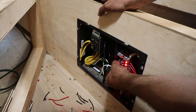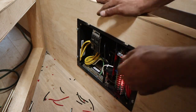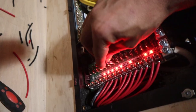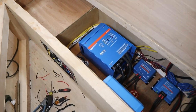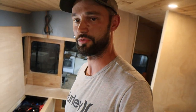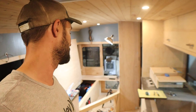We've got the panel wired up. Now we just got to find which one's the LEDs. That's actually the bathroom — alright, we found the bathroom light. Now we want to find the main interior light. And there it is! Ivan, you were a challenge here, but the solar system's completely in. At this point I think we're done — I just gotta do some testing. I'm waiting for an AC breaker for a 20-amp single tandem to come in, but the system's done and the wiring's in. If you guys are interested in putting your own system in, I hope you kind of saw the way it works and how it goes in. The lights are back on in Ivan, which means we can close up the bed and move on to the next task.